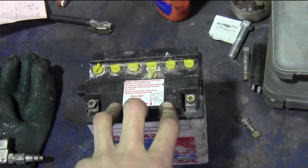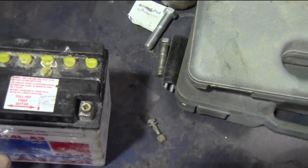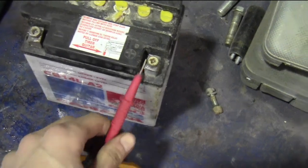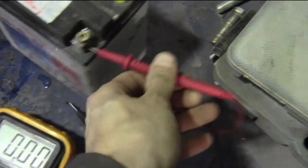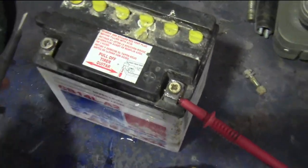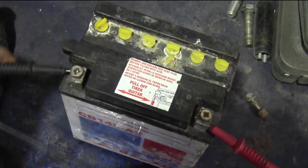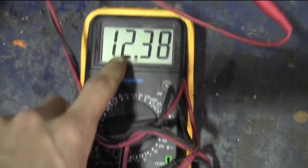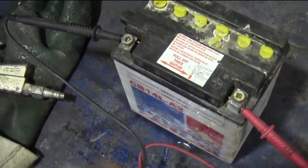It would charge at six volts and it would stay at six volts. Right now, this battery was dead frozen — it was just a solid brick a couple of days ago. Now I'm going to stick my voltmeter on it. Apparently I don't know how to use tools and work the camera at the same time. But look at that — 12.4 volts, and it's staying solid at 12.4 volts. That's good for a battery, just above 12 volts. It's a good sign.